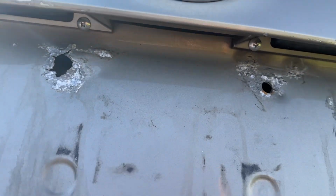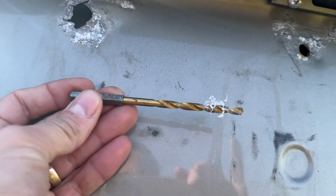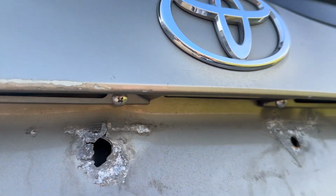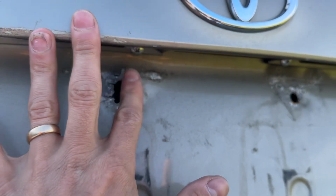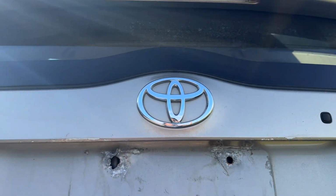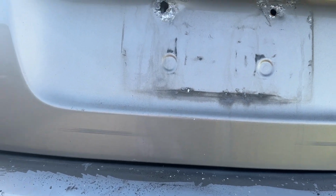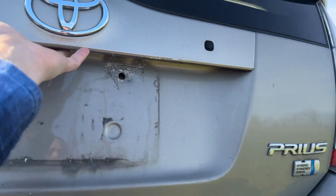I drill a pilot hole with a skinny drill bit like that, and then I drill a bigger hole, so I'm not actually screwing into the plastic, I'm just passing through it, and then I gently and carefully screw into the aluminum pilot hole that I drilled. I make sure that it's snug up against the plastic, but I don't crack the plastic. What that does is it might last indefinitely, or a brand new one can shatter because here in Rochester, we get snow in May, we get snow in October, every couple years at least. These freeze shut and then this gets ripped off.